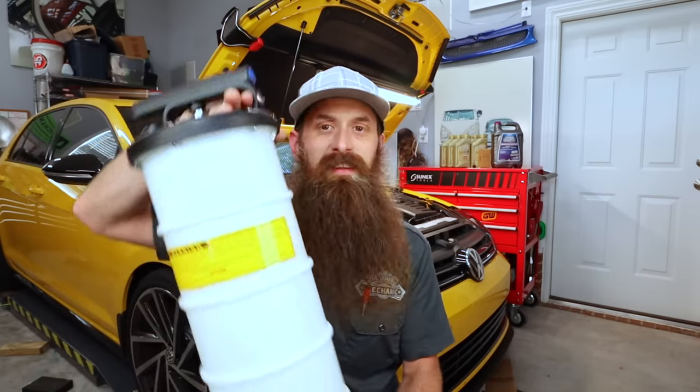Now, a couple things on using the extractor, which if you want one like this, I think this one came from ShopDap. I'll drop a link down in the description. You really wanna do this with the engine warm. If you do it with the engine stone cold, these things take forever, and the pneumatic ones are even worse. So you do wanna have a warm engine. It's also a good idea to know how much oil the engine holds, so you know whether you got it all out or not, or at least the majority of it.